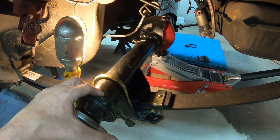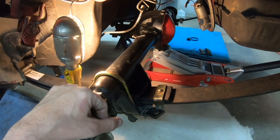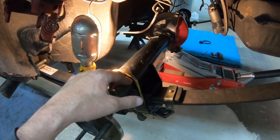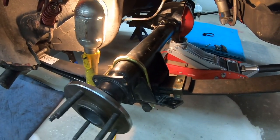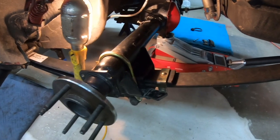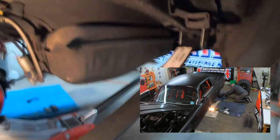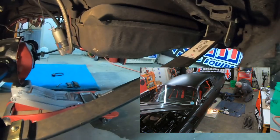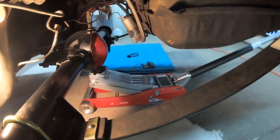Now it's ready for the rear end to come out. You can do this a couple of ways. The young hard-ass way is to pull the jack out, unbolt the U-bolts one on each side, and muscle this thing out on your back. That's feasible since the 9-inch going in is all apart and pretty light. But if you're intelligent, the smart way is to disconnect the springs on each side, let the jack down slowly, then unbolt it and drag it out the back.